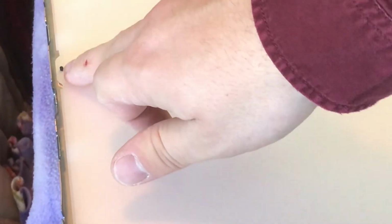So as you can see here, I'll try and show you. Again, that's how you can keep things at the same place when it comes to the TV. These little black nubs on the top half of the TV, and the diffusion screens have holes in them specifically for those. So just keep an eye out for those so that you keep everything on the same side. It's not the end of the world if you don't, but that's how you can keep everything right side up. So now that we got all those in, let's work on the next thing.